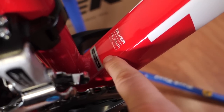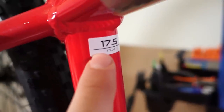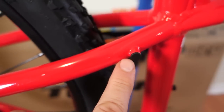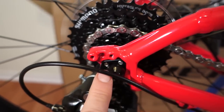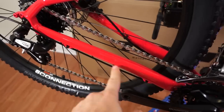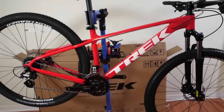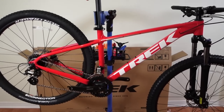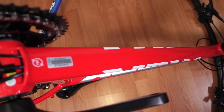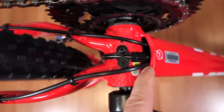If you look down here, you're going to see that this is what they consider to be Silver Alpha aluminum — yes, it's made in China entirely. And back here you're going to see the size. This is a small-medium; they also have 18.5 which is considered to be medium. You have attachment points here for a rack. You can see QR again and how the rear derailleur cable is routed underneath the chainstays. Chainstay is 438 mm, and together with that 69.5-degree headset gives you a good, somewhat modern, cross-country-ish geometry for a 29er.